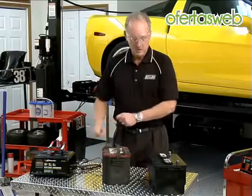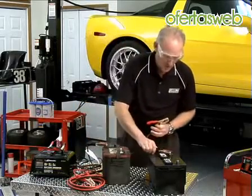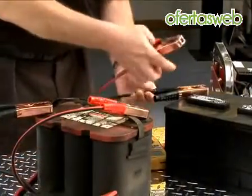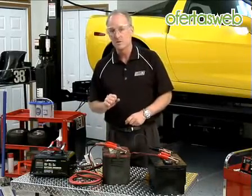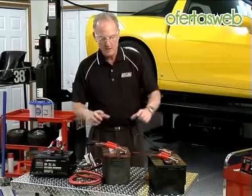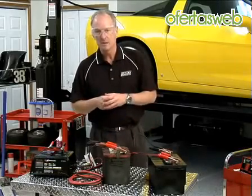What we're going to do is trick the charger. Let's hook up the jumper cables: negative to negative, hooking this up in parallel, then positive to positive. Now we've created two batteries in parallel, which makes — as far as the charger's concerned — one battery. As we hook this charger up, it's going to read the two batteries as one but see the highest voltage, so it's going to turn on. All of the amperage is going to go into the Optima battery that's deeply discharged.